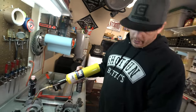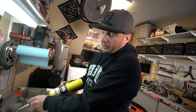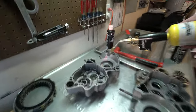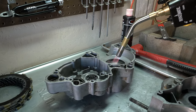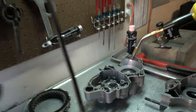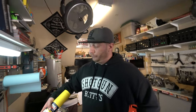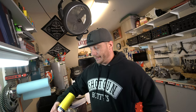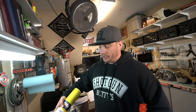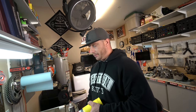Not a lot of people probably have a butane torch — a heat gun you can get for like $10, whereas this rig is probably like $40. But this heats up a lot nicer than a heat gun. Another thing: when you think you got it hot enough, go another two minutes — just for the fact that if it gets stuck in there halfway, now you're driving it back up and putting a load on it. You definitely want it to drop all the way in. The nice thing about doing this is it seats all the way down and you don't have to worry about hitting it and loading the bearing.